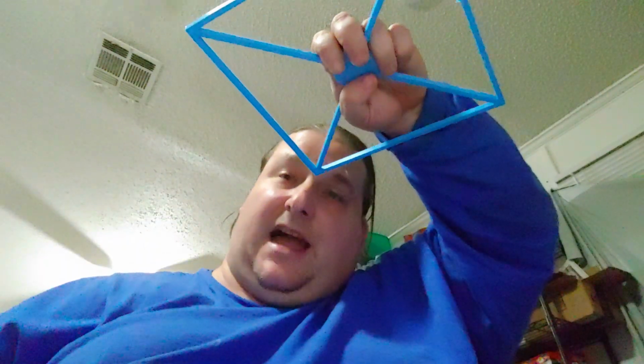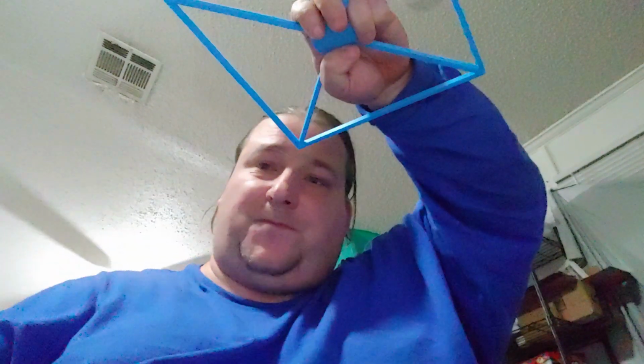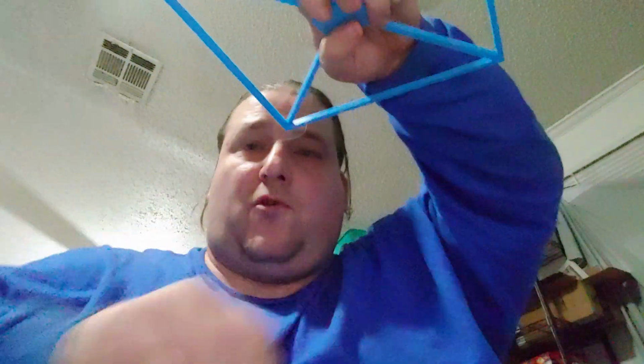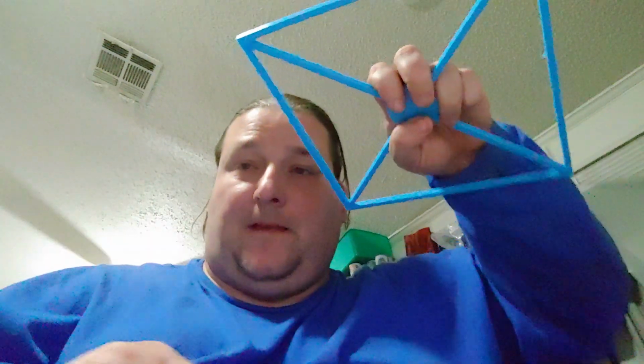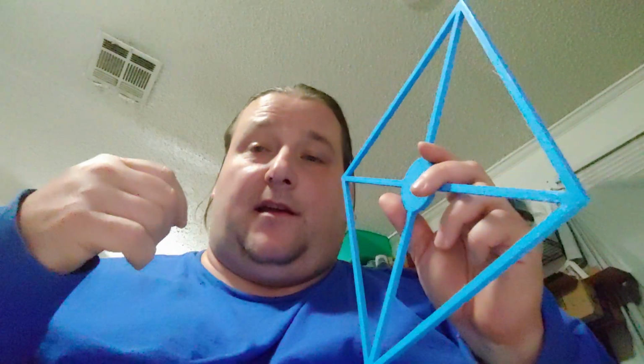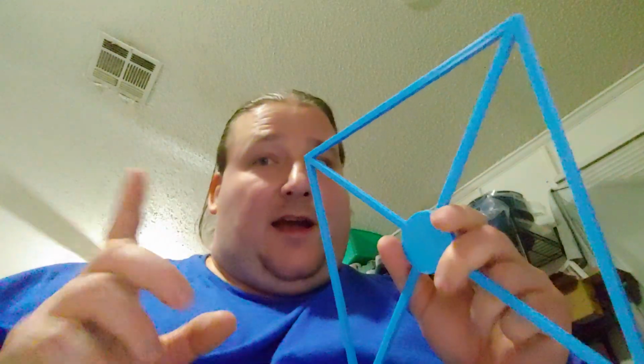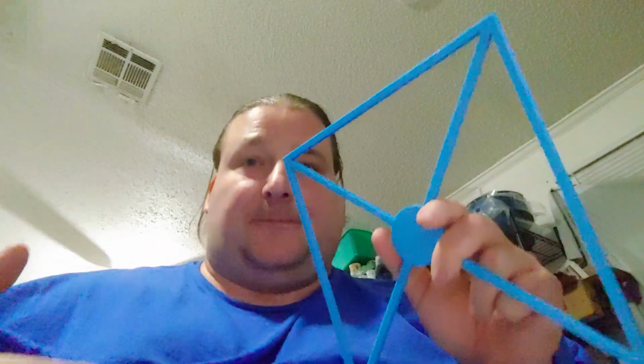Now it knows exactly how far this is from this. So when you tell the printer to print, it homes, and then it moves down that pre-programmed number of steps to get to the bed and begins printing. In his case here, the problem is a limit switch. One of the limit switches isn't working. Why, I don't know yet, but I can help diagnose that.